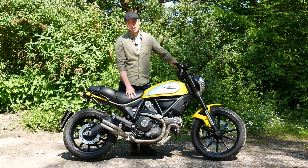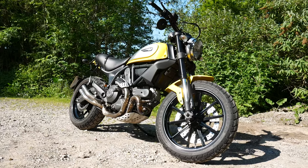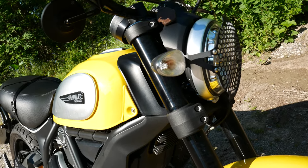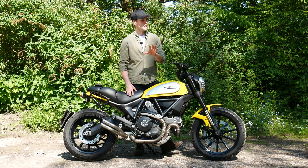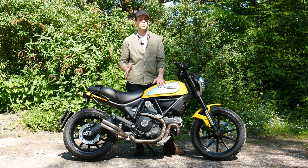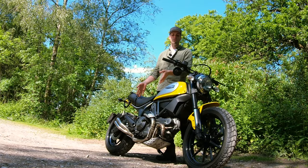It's a pretty short bike as well. You've got a seat height of around 798 millimeters — just under 800. It's a really comfortable, low seat height for beginners and for shorter riders. It's a favourite with beginner riders because of that. The other thing massively in its favour for new riders is that it's hugely light as well — 173 kilograms, let's say 175 dry, so just under about 190 with a full tank. The tank is quite small, but that means it feels nice and manageable, nice and flickable. It's not an intimidating weight at all, even if you're just moving it around parked.